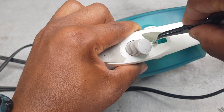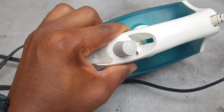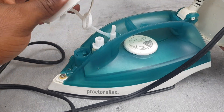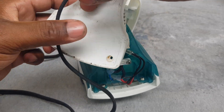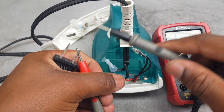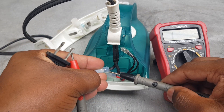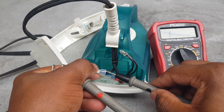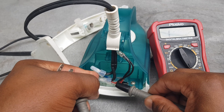I'm going to use a tweezer now and try and bring up the screw. Now the back can come right off as you can see. Now we're going to check the back of this iron. Now put one lead here and the other lead - we're getting a reading of nothing there, which is good. Turn it around - one lead here, which is good, and nothing right here. So this cable is good.